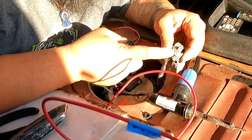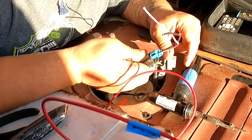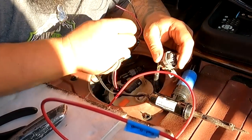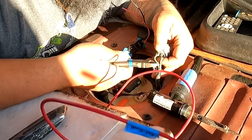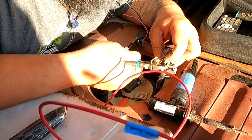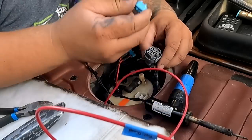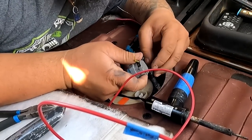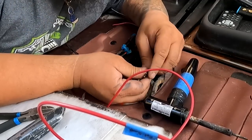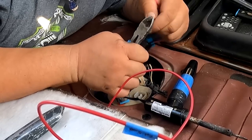This is the plug that goes onto the fuel basket. The signal wire is the yellow-green stripe and the black is obviously ground. Since we pulled both through the bulkhead, I'm not going to de-pin the terminal from the plug. I'll pull it back about an inch and a half and cut the wire from the plug itself. Now we have our two wires — signal for the relay trigger and the original power wire to the pump — plus the ground wire going through the plug. I'm going to go ahead and solder these together.